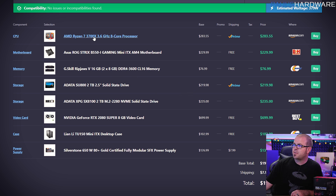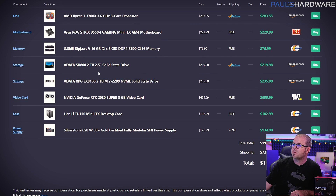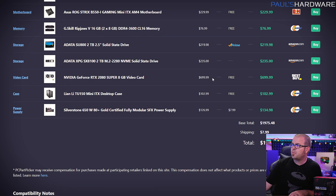For the time being I'm planning for a Ryzen 3700X, the motherboard of course, and a 16GB memory kit — although I'm considering upping that to 32GB with something that has RGB lighting. With mini-ITX you don't necessarily always have a lot of expansion space for adding a mechanical hard drive, so I wanted to make sure right out of the gate we had lots of storage: four terabytes total across two SSDs.